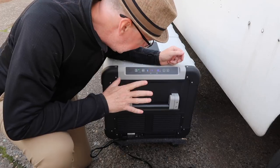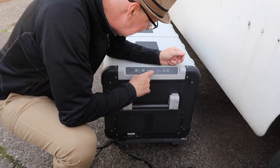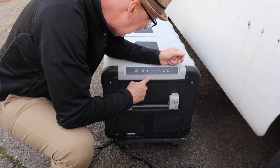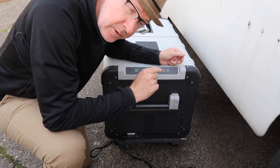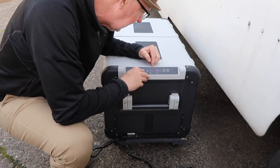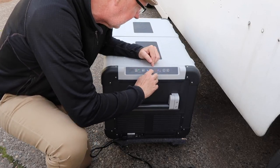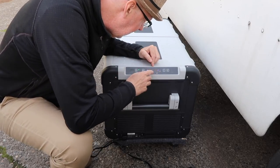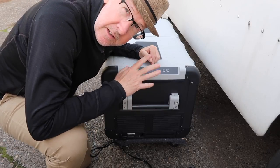Okay, all plugged in — just got to let it cool off. I put it on a dolly so I can move it around easily. When you start it up it's in Celsius, showing 11 and 10. It's been running about 20 minutes. To change the mode you press the set button. On the third press it shows Celsius, then you press the plus sign to switch to Fahrenheit. So now it's displaying 51 and 50 degrees Fahrenheit.